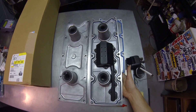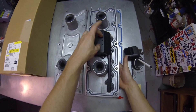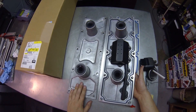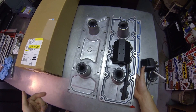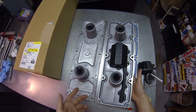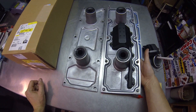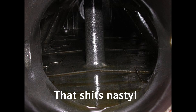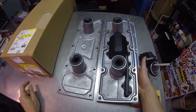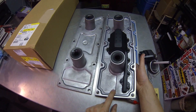Looking at the underside, they're completely different. The PCV on the LS6 draws from the center of the crankcase, whereas with your valve covers, that setup can suck up a ton of oil. LS1s are known to have a ton of oil in the intake, and my last setup had a ton of burnt oil and carbon on the valves due to the PCV. So I opted to just go with the LS6 cover.